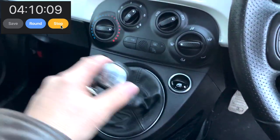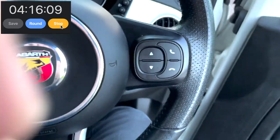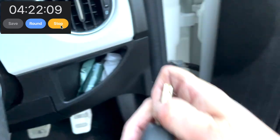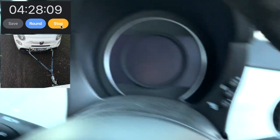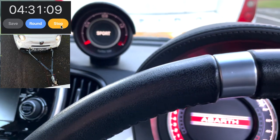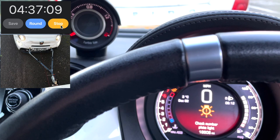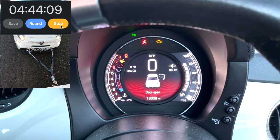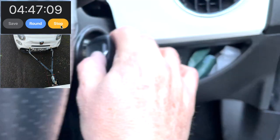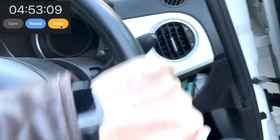Put your car in neutral, handbrake off. Key in the ignition - it can be the standard spare, it doesn't have to be the one with the key fob. Turn the ignition on all the way until the lights come on, then turn the key all the way off and leave it there. Check that the steering lock is not going to come on.